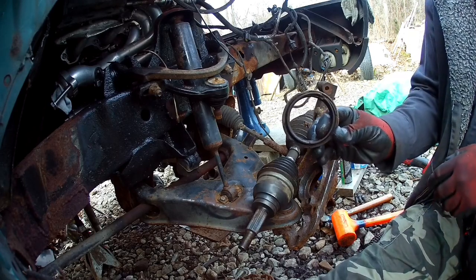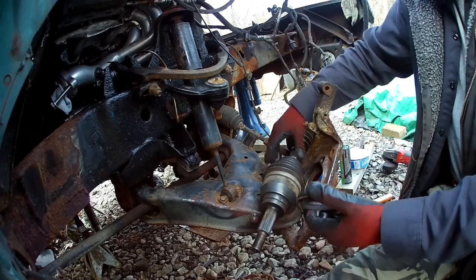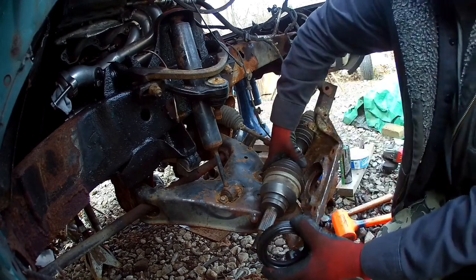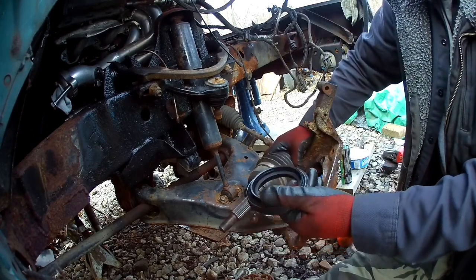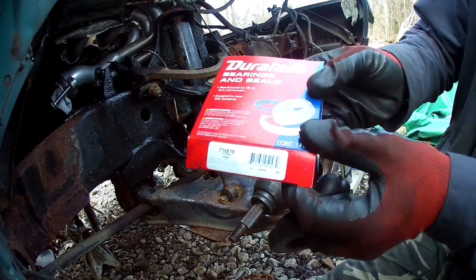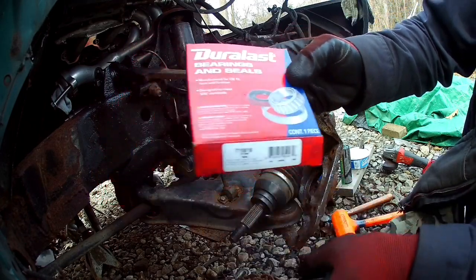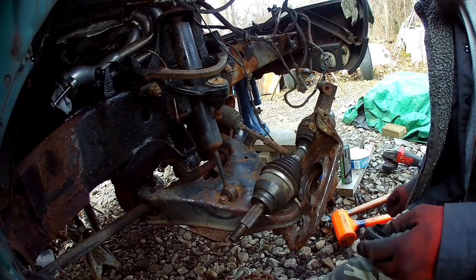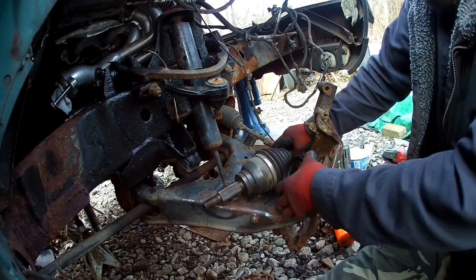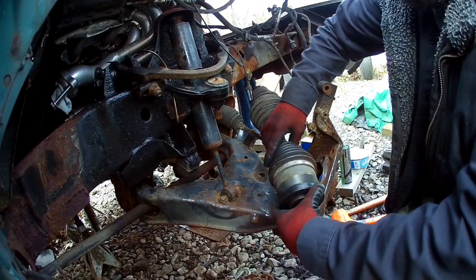So this is the original seal, and they fit on like so. I called up the part store and got this seal, which doesn't. Check the parts. The part number's right. It even matches the Ford part number, which you should be able to see there. I'll put a note in the description. So this new seal apparently fits inside the knuckle like so, which fits against the axle like so.